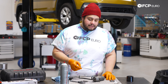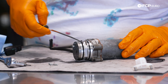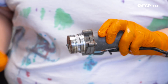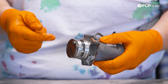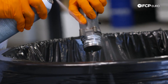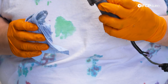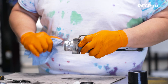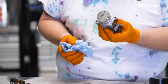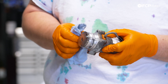Now we're going to very gently pick out the old O-rings, being careful not to mar up the surface they sit in. We'll use our pick to very gently pop them out. Then, similar to the screen over the trash bin, without introducing brake cleaner into the pump, we're just going to clean out the surrounding edges where the seals sit and any gunk on the body. That looks much, much better. It's surprising how much gunk stays inside the body here. You definitely want to stay on top of this surface every three years or 40,000 miles — but I would stick to three years whether you're hitting that 40,000 mark or not.